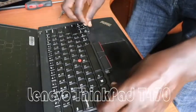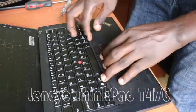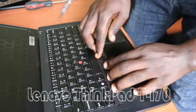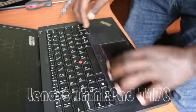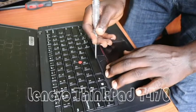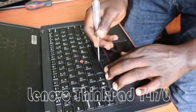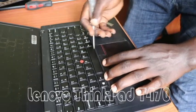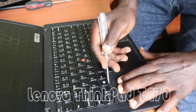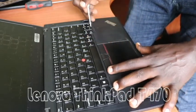Then flip and close the keyboard just like this. Make sure it first enters that side, then press it downwards as you slide it back into the locks. Gently slide it back — you can use the help of a minus screwdriver — and ensure that it fits in very well.